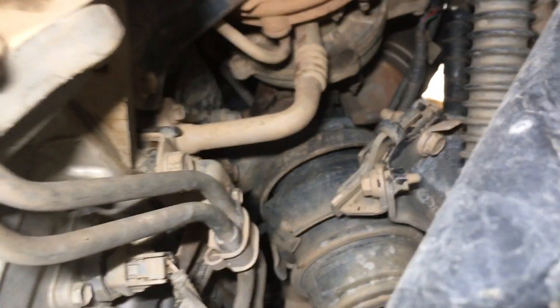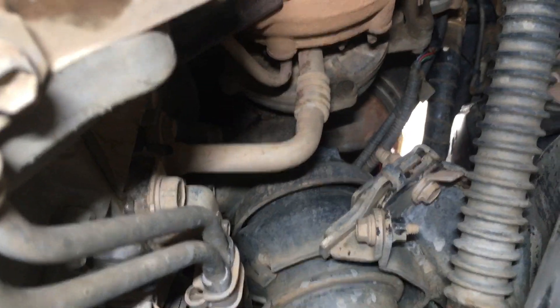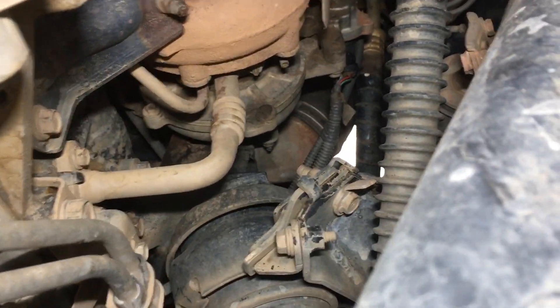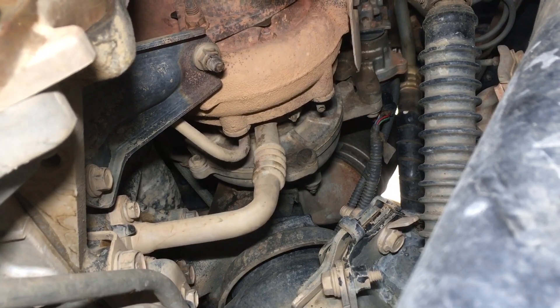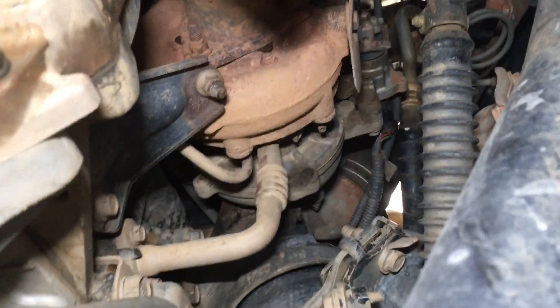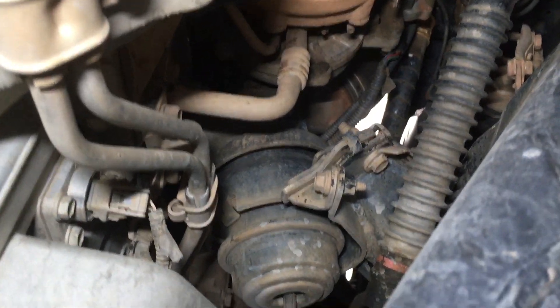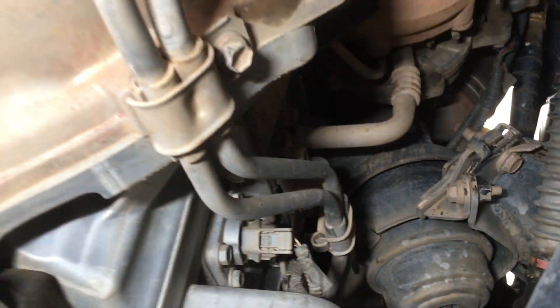If you look up there, below the turbo - in between the turbo and the pipe at the bottom of the turbo - you can see that insulation. That's what I was talking about being in the way of the nut on top that you need to get to, sort of right in the middle of the picture. These sorts of wires and things you want to get out of the way. You won't want to take the inlet side of the turbo off - you'd need a gasket for that, you can buy a gasket kit for about 60 to 80 bucks. Those gaskets are usually okay to reuse anyway. You can get them out by undoing the bolts up on the block each side of that pipe coming off the turbo, above and below it - you might get that out of the way and that'll help. Either way, they're quite fiddly.